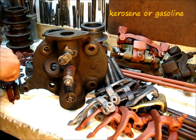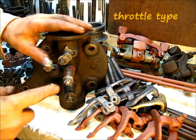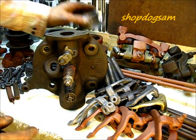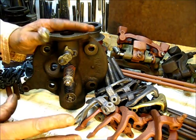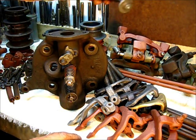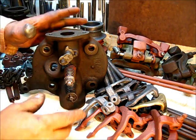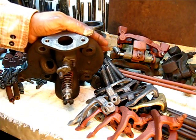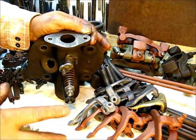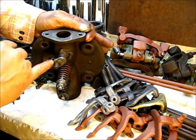Let's start right here and work our way backwards describing the governor system. I do have a side cover where the locating pin broke off — we'll do a machining segment to replace that pin. The governor system is what differentiates between a throttle governor engine and a hit-and-miss engine, and this is how that mechanism works.